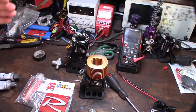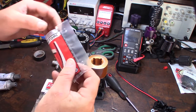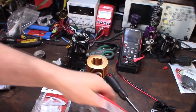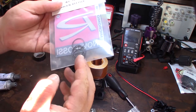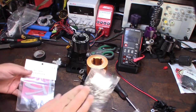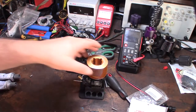I'm kind of going off on a rant there, but this is the right way to do it — it's called a gasket. Never use RTV. Only use RTV if it's like an emergency. I mean, it's never a permanent fix. They do actually make gaskets for the rear case and the carburetor. RTV is the worst.